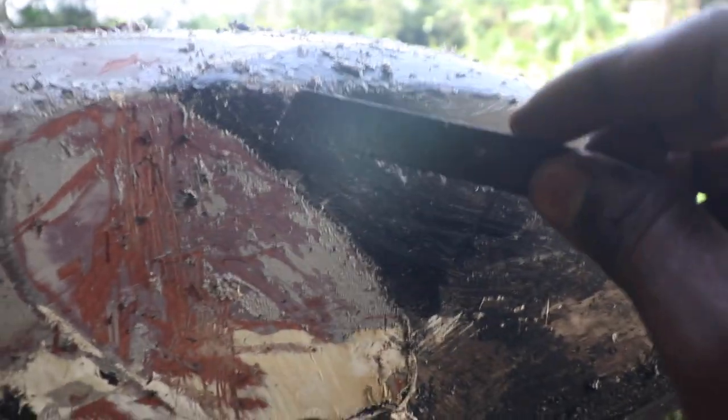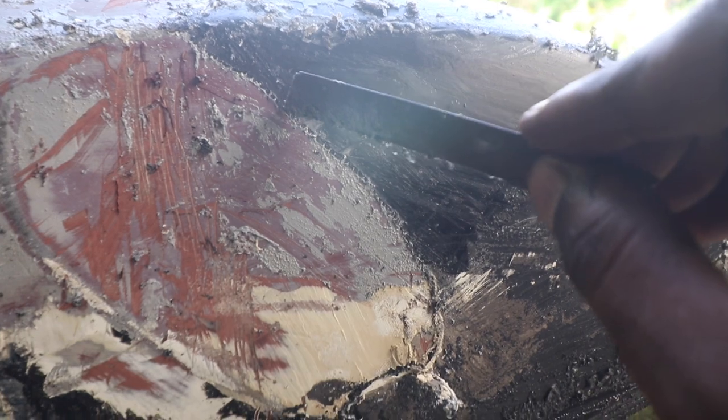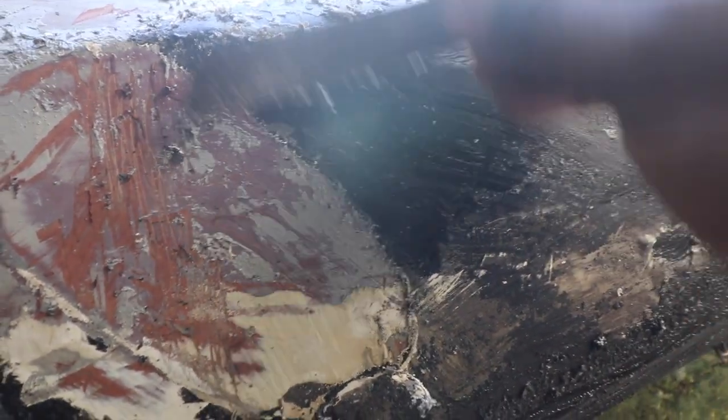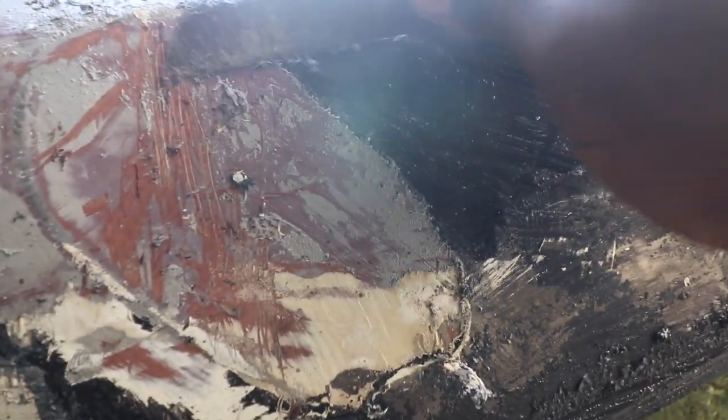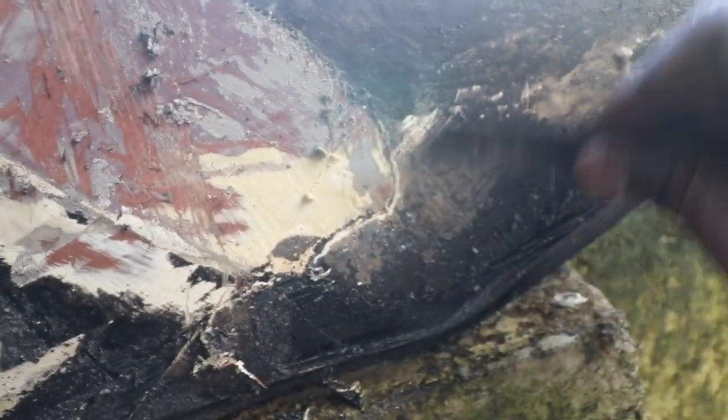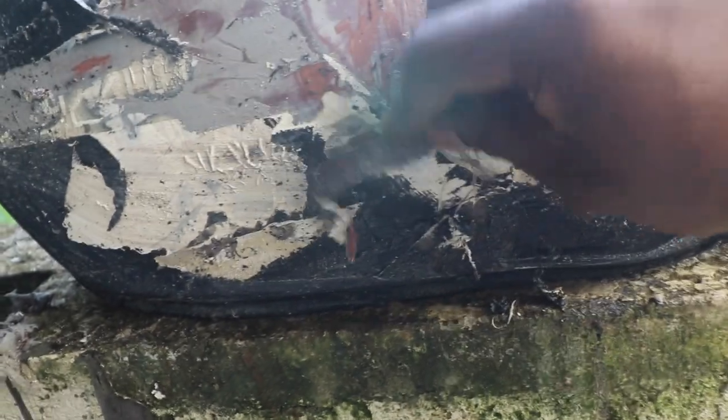As you can see there are multiple layers — there is a black, then another black here, then below that a gray, then another gray, then a red primer, and under that is the metal body. Places like this have a lot of putty on them, so we'll have to scrape all that and see what the condition of the metal is below, because if there is a problem in the metal it might start leaking in future — and our builds have to be 100% perfect.